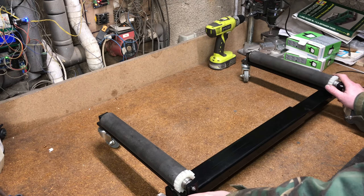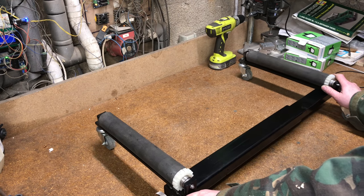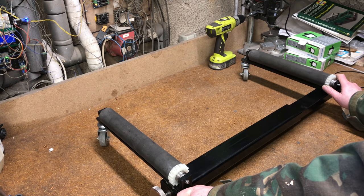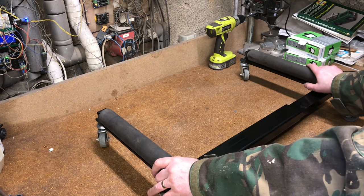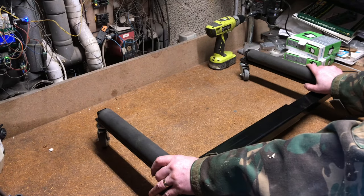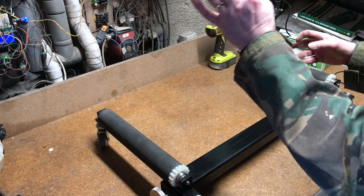Here's a tighter shot of what I've made. You may recall from earlier videos — I've got a Land Rover Defender that's got alloy wheels on it now. It used to have steel wheels, which were fine — two and a half millimetre pressed steel. When you fitted them onto the hubs you could easily fit the studs through all five holes and do the nuts up without a problem. The problem I'm getting now is positioning the new alloys over the studs and being able to get the nuts on, because the nuts are sleeved and I've got to get the sleeve through the hole in the alloy wheel. I'm having a job lifting the wheel and positioning it so all five studs stick through with equal distance between them for the sleeve nuts to fit onto.